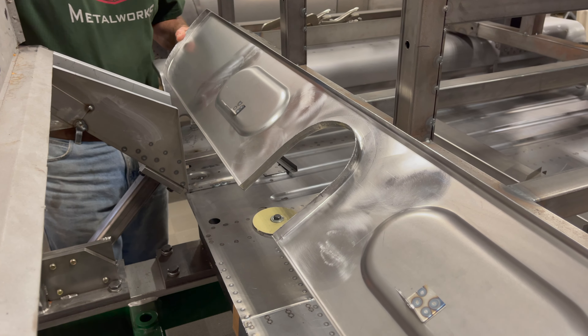This panel is going to get dropped down in here next, and we still need to do some trimming of this bottom edge to fit around these chassis legs. Going back to the fact that these inner sills are a little short — I've been positioning them properly in the front based on the jigs, but then the rear end is too short, about 3/16 to a quarter inch. What I could do is just bend this flange and spot weld it — that's what they would have done at the factory — but I'm just too precise for that. So what I will do is cut this flange off, use straight edges to get the exact positioning, and then re-weld on a new flange that's in exactly the right spot.